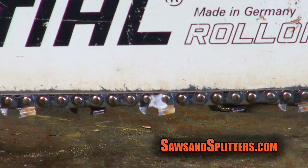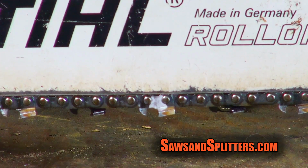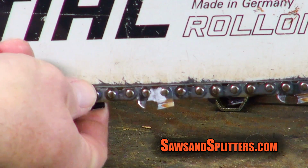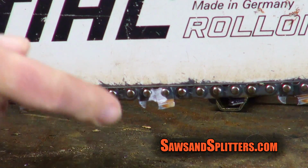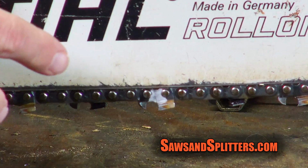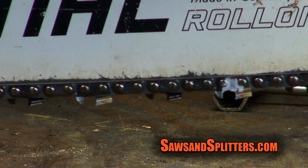So guys, I think I got this figured out, and it turns out that it's operator error. I was playing around with the saw a little bit, and I kept looking at it and trying to figure out what I could be missing. And I'll show you what I think's going on here, but first let me just show you, I tightened up the chain. It's not super duper tight. It's tight, and I think part of the issue that I'm having is that on a longer bar, your chain has more slack, so when it slackens up a bit, it slackens up quicker. If that makes sense. But let me just move it around the bar for you guys and show you that it is staying on the bar.